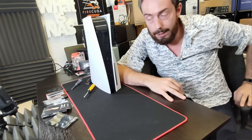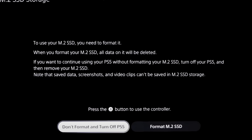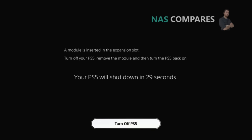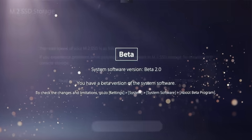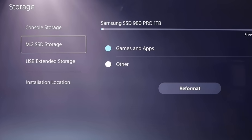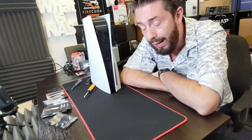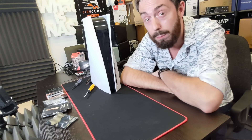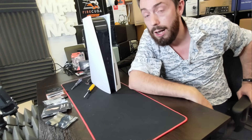Once you install the SSD and power the device up for the first time, it will acknowledge that an SSD has been installed. If you try to install an SSD before the SSD bay activation, the system will ask you to shut down and remove the SSD. But if you have the new software beta or a recent update from PlayStation that enables that SSD slot, you'll be greeted with a test screen to enable that bay. Go into the settings menu, into the storage manager, and activate your SSD bay. The physical installation is nowhere near as complex as people make it. I hope this video has helped you. Click like, subscribe — we're doing a whole feature series on storage for the PlayStation 5. Use the links in the description for all compatible SSDs and my full list of guides. See you next time.